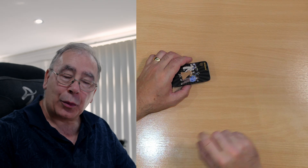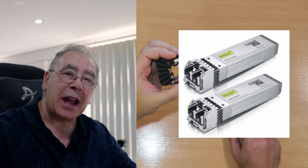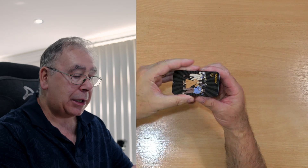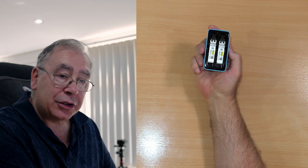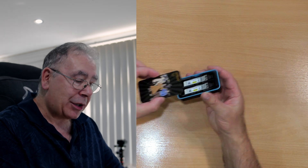It should work, but I've never tried it. I don't know if I have to do any reconfigurations but I don't think I do. If it doesn't work, we'll go from PC to switch and switch to PC — I know that does work. So with that, let's get on with the actual parts list. To start with, you will need this: it's a two-pack 10 gigabit SFP+ transceiver. You get two in this pack — you need one to go in the switch and one to go into your PC.